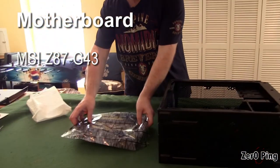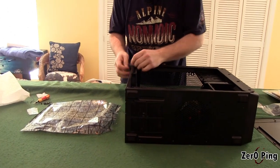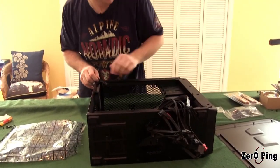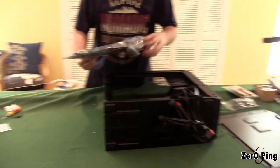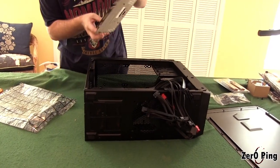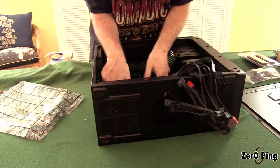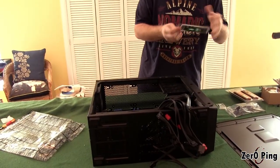Now we've got our motherboard. There are a lot of different things going around the internet regarding not frying componentry. One of the old adages is always touch the inside of your case — in theory it should be grounded and prevent you from blowing something up. There are a lot of people who will tell you that doesn't work, and a lot who will promise that it does. Do a lot of research and just take general precautions. Don't wear anything too baggy or anything that builds up a lot of static, because you will do untold damage. Don't be silly about it.